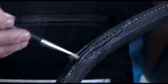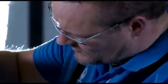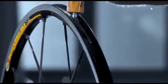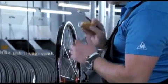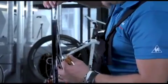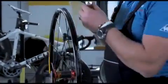Once the rim and tire have been prepared, let cure overnight, or even better, a whole day, before mounting the tire. Before you mount the tire, complete the cement base on the rim with a final thin coat. When applying this last coat, you can leave out a 5 cm section on the side opposite the valve, so you have a point to pull off the tire in the case of a flat. Racers accompanied by material service should apply the cement all the way around.